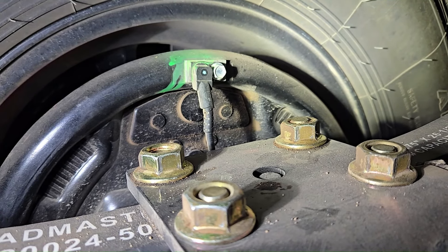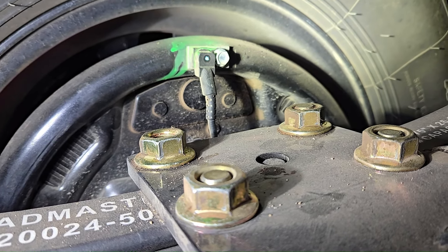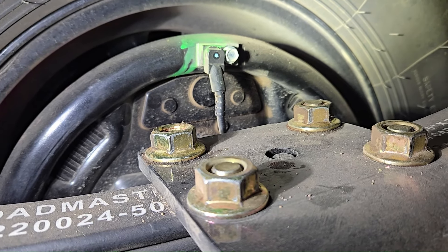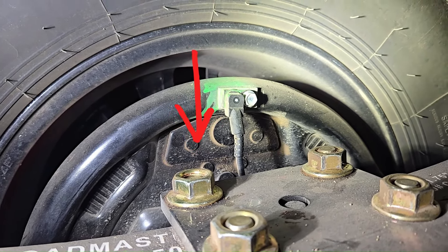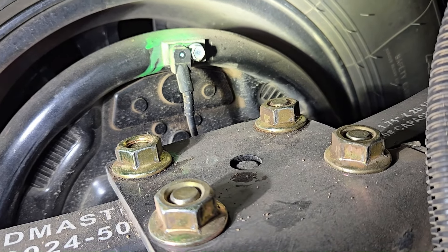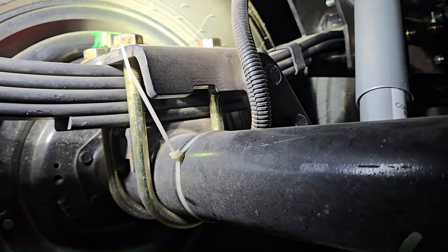This past weekend we took the camper on its longest journey yet. I figured we'd just keep monitoring these U-bolts and nuts that the dealership put on — which, according to a few others who install this kit for a living, are incorrect. Look at the back left nut: the other three are right up to the top, but that back one is already starting to back out, and we haven't even cruised 200 miles on this suspension. So we're going to swap all these out for the correct ones.